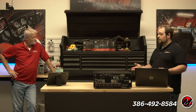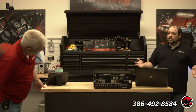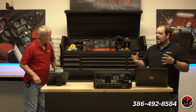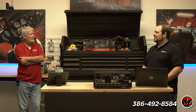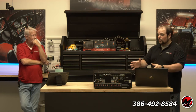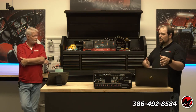Let's talk about HDMI in a receiver. We've got up to seven or eight HDMI inputs depending on the model, and sometimes multiple outputs — zone one, zone two, zone three. There are actually a couple of AVRs that treat themselves as a matrix, so you can send any input to a different output. But for zoning, it's better to put in a true matrix and a distribution system for music rather than trying to cram everything into the AVR.